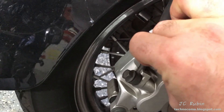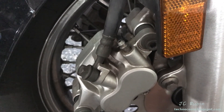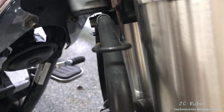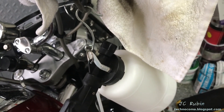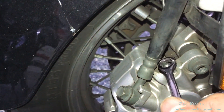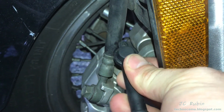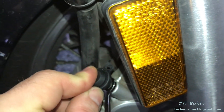I'm going to pull off the protective cap from the caliper. On cars there's an argument about which brake to start with — the furthest one from the reservoir — but in this scenario both calipers are equally distant from the reservoir, so it doesn't matter which one you do first. I've hung the brake bleeder just under the throttle, close enough to grab the handle and work with it as I bleed the first caliper. I take the eight-millimeter spanner and put it over the valve, making sure I have room to work in both directions. Then I take the rubber fitting from the pneumatic bleeder and lay it over the bleeder valve, making sure it's securely fit.